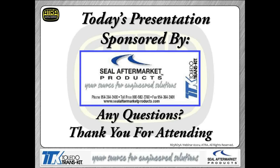I like to put the TCM inputs and outputs in the handout material. If we're having an issue with an adaptive strategy not wanting to work, or issues with relearn, or a code that won't go away, we have some sensors that we need to look at. Like, for example, this ASCD, that's the automatic speed control device. Sometimes guys get confused at actually what this means. It's basically the steering column and any speed controls in the steering column that would affect the transmission, like cruise control or the overdrive cancel signal. That's all done through the steering column.